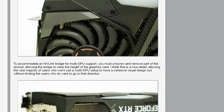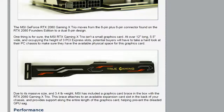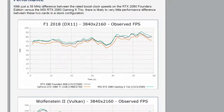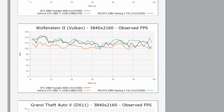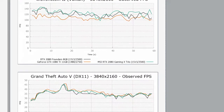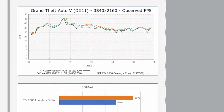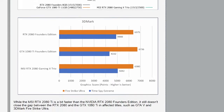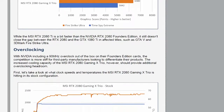Two 8-pin connectors on this as opposed to an 8-plus-6-pin connector, so you get in theory a little bit more headroom there. From a performance perspective, it is probably just a handful of percentage points faster than the 2080 Founders Edition — nothing significant out of the box, but it does give you a little bit more headroom for overclocking. Although these cards are all still topping out at the same frequencies because of the way GPU Boost is implemented and because of voltage limits.